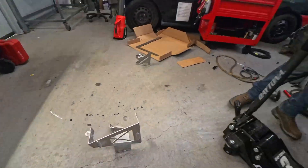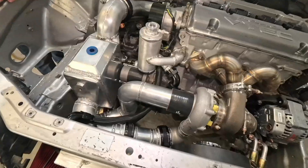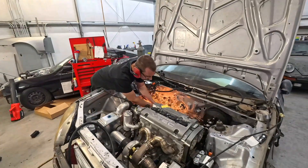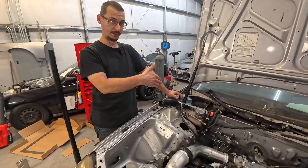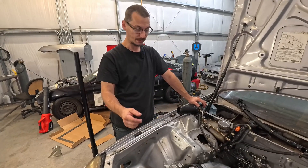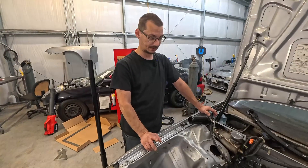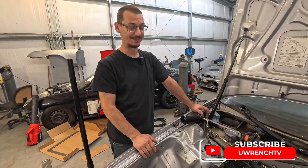That's the old bracket for the intercooler, which I'm going to remake. I put everything back in with the intercooler, the pipes, and the intake manifold, and found out that with the rear mount in there the intake manifold hits the black part of the mount — the bracket that goes to the transmission. So I'm probably going to see if Hassport offers a redone one, that way I don't have to do anything and we can just buy theirs and put it in. If not, I'll have to remake that so it clears better because I don't like the grinded look. Then I'm going to start making the reservoir for the water, and I have a pump picked out for it. I also changed my mind on the heater core — I think we're going to keep coolant going through it, but I have an idea to change it and still make it seem cool.